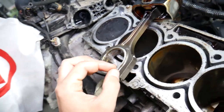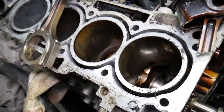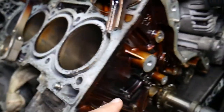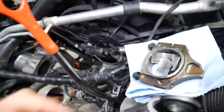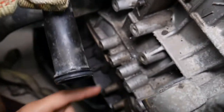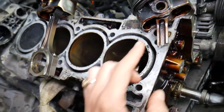If you keep driving after hearing that knock, the bearing will spin even more, get really hot, and mess up your crankshaft badly. The bearing will get glowing red; everything will be covered in smoke inside the engine — you can see how black everything is because of the bad bearing. Eventually, you can break the connecting rod. What happened here is the connecting rod snapped in two — a piece got stuck in cylinder number two and cracked the engine block on the outside, making the engine block no longer savable.